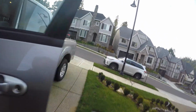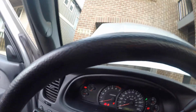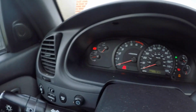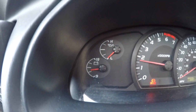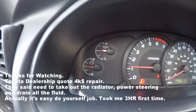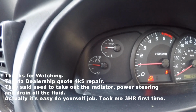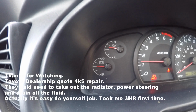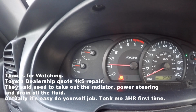Okay, now we're going to turn it on and try to start the car. Hopefully the battery gauge will not go crazy up and down like that. So here is the battery gauge. Start the car. What a surprise. Everything just worked. So now we can see that the alternator is regulating, right? If I push the gas, it is stable, and if I loosen the gas, still stable. So we know that it's not going up and down crazy.